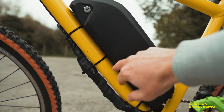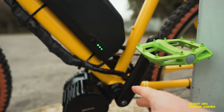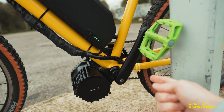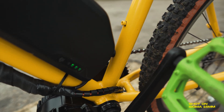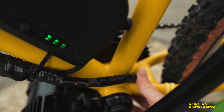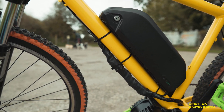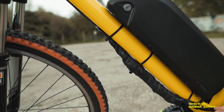The battery fits where your bottle cage usually goes. The other components are the cabling — the wires and stuff — which is the messiest part of these builds. I've tried to tie them up and neaten them as much as I can and get them out of sight. Some people bundle them underneath the motor, but I wasn't too sure about that. This bike has a little bar running along at the back, so I managed to feed a lot of the cables up through that gap to keep them out of the way of the crank and wheel.